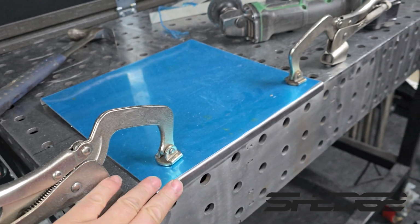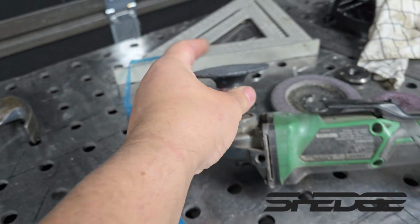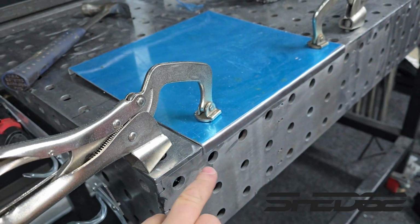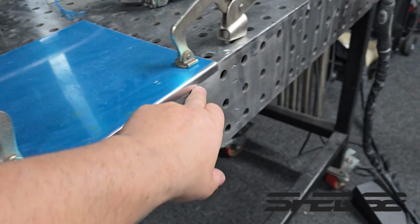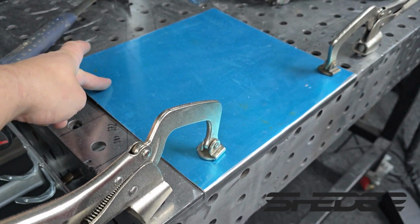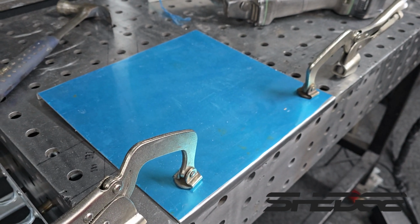But nonetheless, we'll use the hammer to hit it over and then just quickly linish it off with a fine Rolock just to get rid of all the dents and stuff. So it's running nice and true now. So what we need to do now is put it on the linisher, get that face running nice again, and then yeah, do our fold here, and then obviously we have to cut out our fan holes.